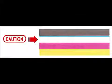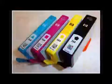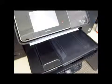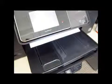You may continue to print until print quality begins to fade. Identify the respective color by running a self-test or print quality report and then bring that respective cartridge or cartridges in for refilling. To help maintain printhead health, it is suggested to print on a regular basis using all colors, perhaps once or twice a week. This will become more important as the printer ages.